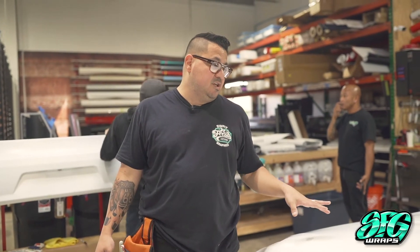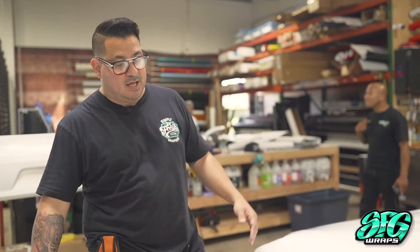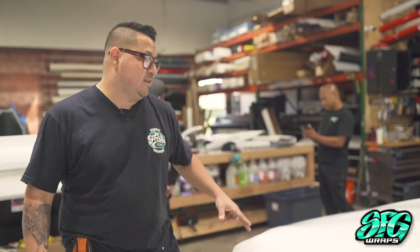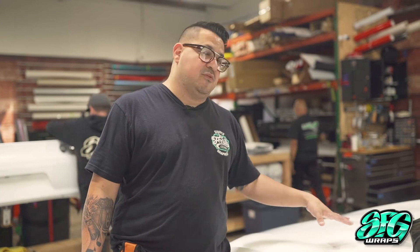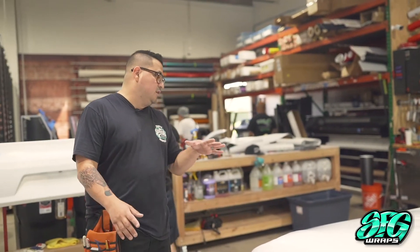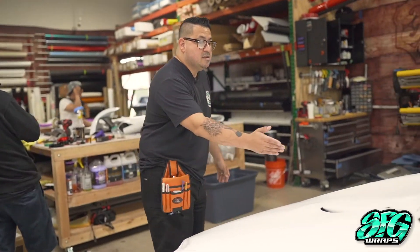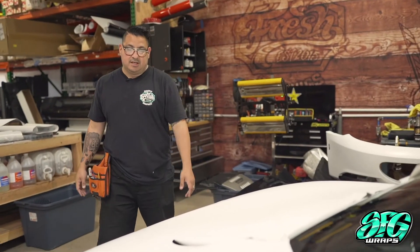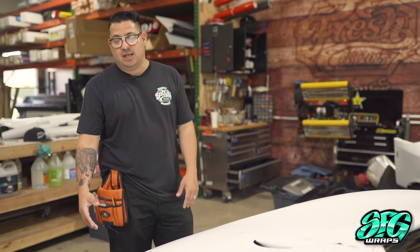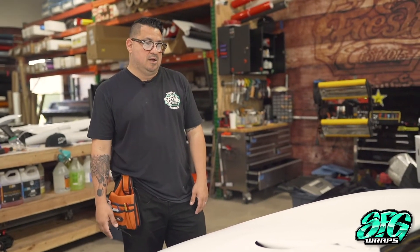We just stretched the hood onto the Lotus Evora. It was an 80-inch piece or something like that. The hood wraps around — it's a lot like an R8, it wraps all the way to here. We had to manipulate the film and stretch it in a couple of different ways, but I think we've got it perfectly glassed out now. We cut a relief here, which allowed us to shift that way, cut a relief here to shift it back to the middle, and obviously the same on the other side. The hood's all glassed out now and now I can actually start laying it. This way we know there's no oddball tension anywhere and it'll last.